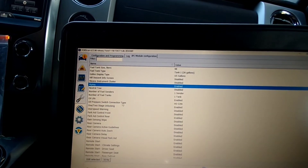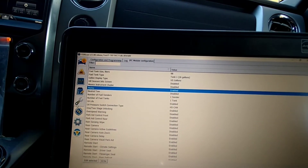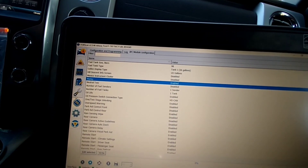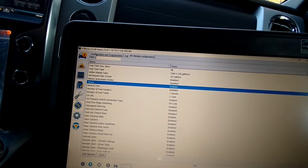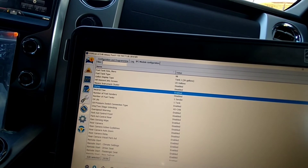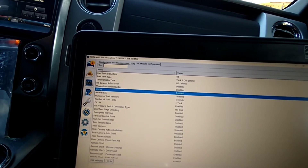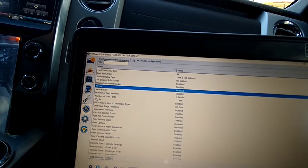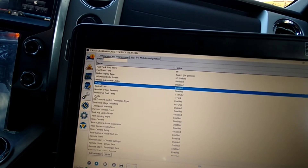The reason MyKey is enabled again on ours is because I wound up programming a new key with this program. Once I made a new key it actually acted as an admin key, so I was able to enable MyKey and use the new key to get into the dash and clear the MyKeys. Even after turning MyKey off the radio worked, volume turned up, but the speed limiter was still set at 80.